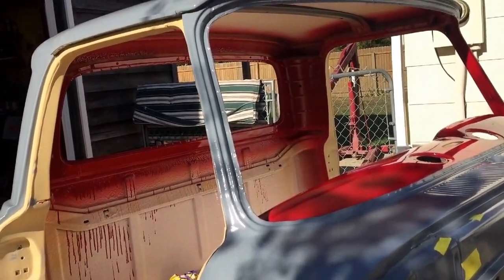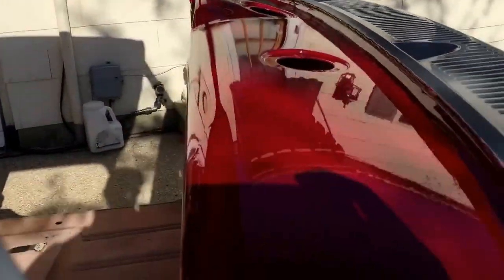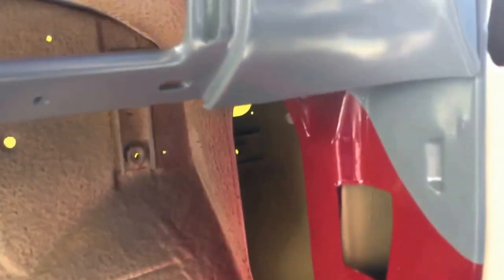Out in the sunlight Sunday morning around 10 o'clock. I've got some issues to work on - I had a big run right there I didn't see last night, so I'm going to take some wet-dry sandpaper to it. I did the door panel here and I really like it; I'm hoping it'll work out nice with the door transition on my curve. Had a little bit of a problem with the paint so I'll have to sand that down too. Overall the line looks good but I've got a lot of runs where it came off the edge.